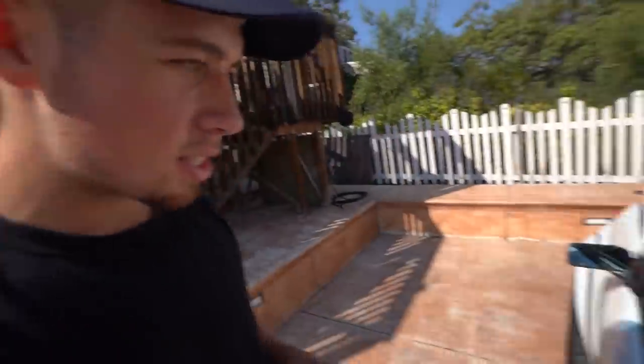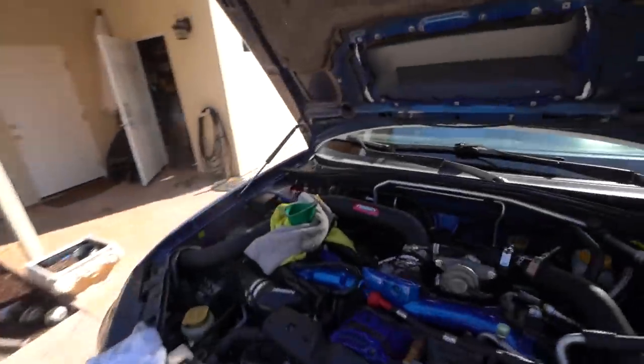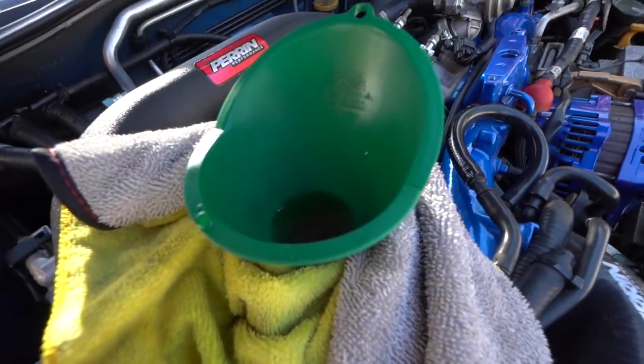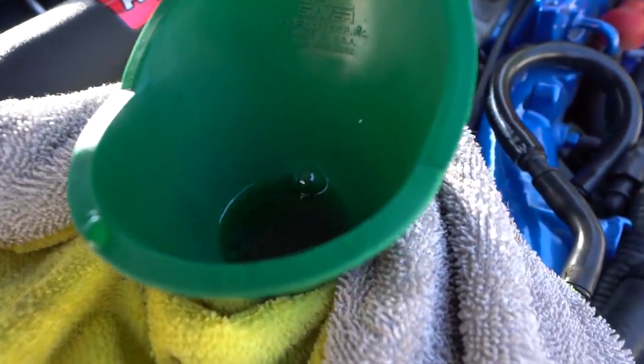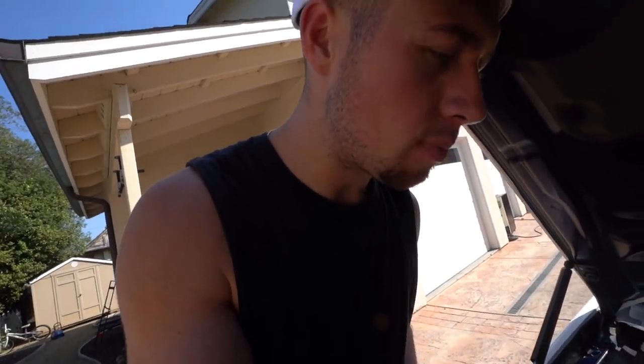I just threw the heater on full blast — making sure the AC button is off — and temp is slowly rising. We're going to see if there are any bubbles coming out. We're going to wait till the thermostat opens up. Once it opens, you'll see the coolant level go down and that's how we know the air bubbles are getting out. The thermostat opened and we did get some good bubbles. Level dropped quite a bit — adding that new coolant route with the mod, it might take a little more. Definitely getting good bubbles, so I'll keep filling the system and make sure we get all the air out.